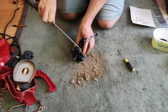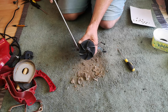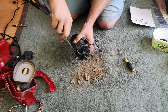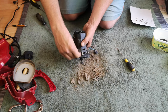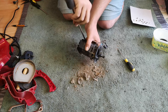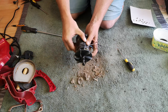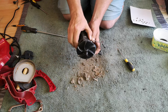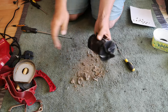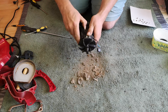I think we can just undo the other screws that hold the motor together and get everything from the back, so we can hold the armature to remove the fan - that's always the easier way to do it. We also have a back fan which will need to come off too. So we'll take out the three remaining screws and then the housing should just separate like so, although it's caught on something.